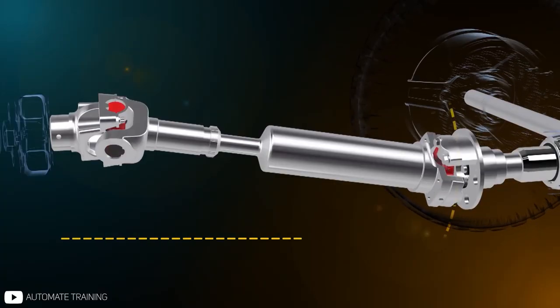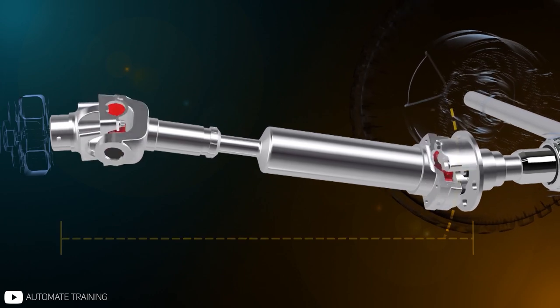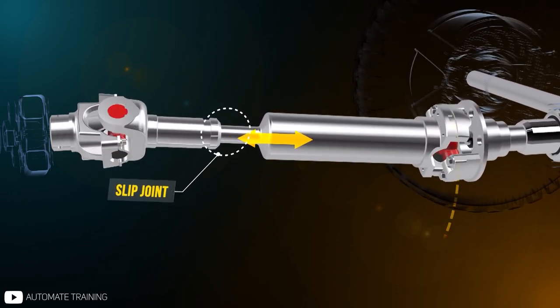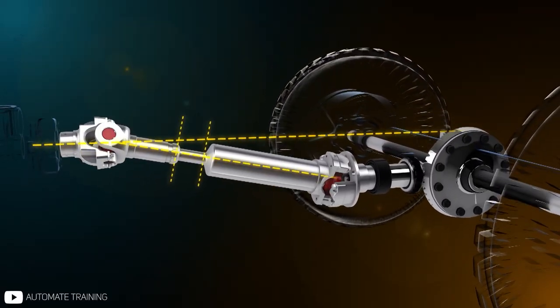The last big aspect of a solid axle lift is the driveline angle. Once the axle has been moved down, you must remember that the drive shaft still runs from the axle to the transfer case — and when that axle moves down, the shaft must get longer in order to reach. All drive shafts will have an ability to become shorter or longer, usually by means of a slip yoke. A factory drive shaft will have different limits depending on what vehicle you're running — some have a lot of slip, which allows you to lengthen them, and some do not. For the most part, most factory front shafts are long enough to work on a lift, but the limiting factor is the operating angle. The operating angle of the drive shaft is the relative angle of the output from the transfer case and input to the front axle in relation to the drive shaft. At some point, the front axle will become too far away from the transfer case and put too much angle on the drive shaft U-joints, which will cause them to bind.